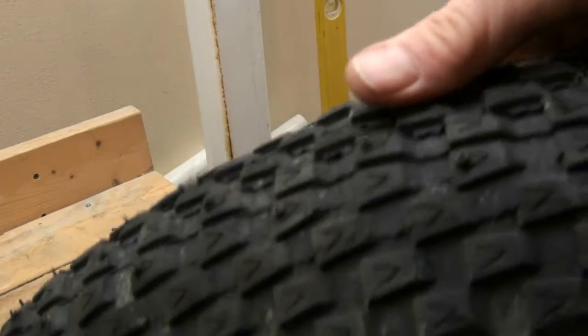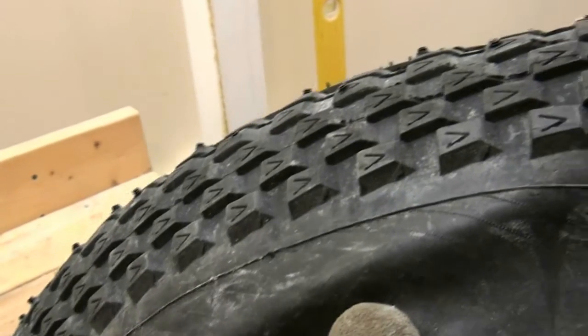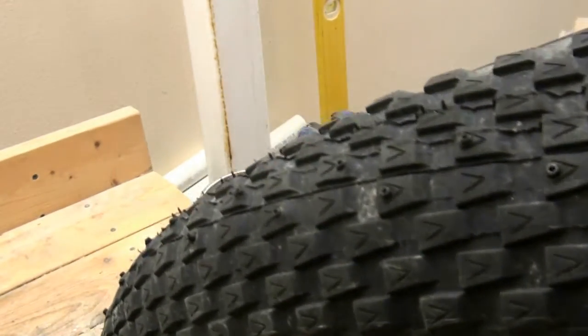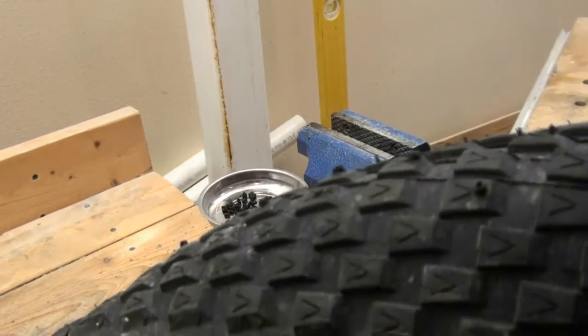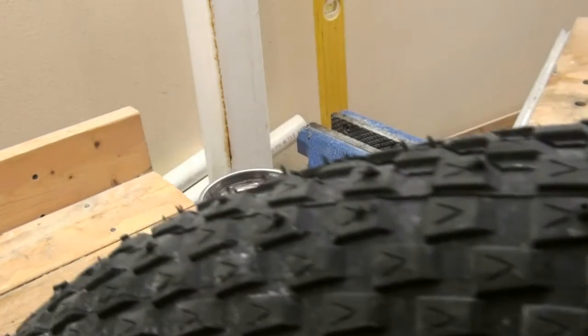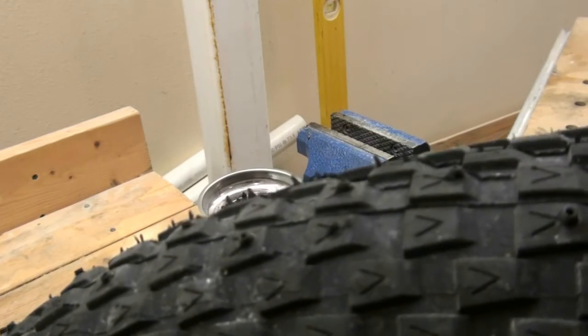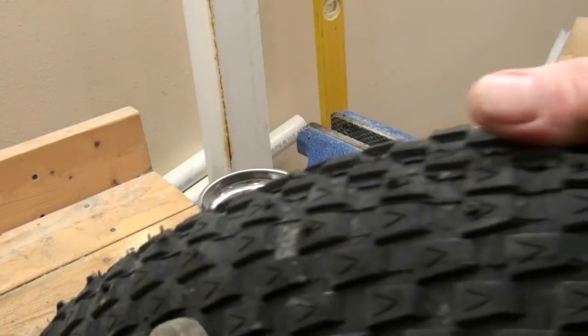This is what it starts with, and when we're done with it, look at it at an angle — you can see the set screws sitting out there. I put them every inch and there are 89 of them. Theoretically there should be about 75 for a 26-inch wheel at one per inch, so I'm not sure why there are more than that.